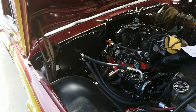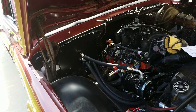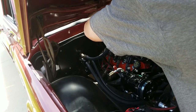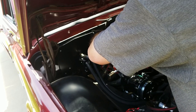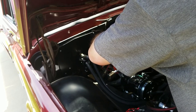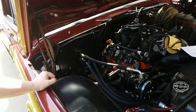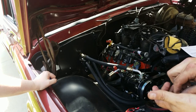So then you got to put on the correct size O-ring out of the bag. How do you know? When it goes on correctly. They're all green, because you can see. Right. I never looked at the difference in the material. Like, why are they green versus not? I don't know. Maybe it's the brand. No, all the AC ones I've seen are green. So then you take some of this mineral oil they provided and put it onto the O-ring.